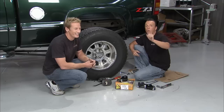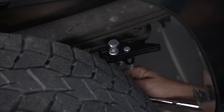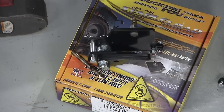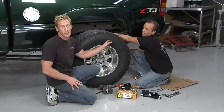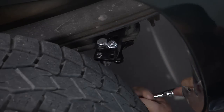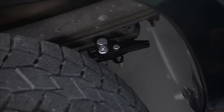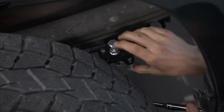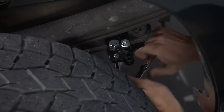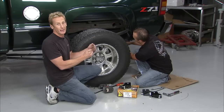The install goes in pretty quick, and if there's a situation where you have to do drilling, they give you the drill bit you need. Most of them will bolt right into place for most applications, and it engages and disengages in a matter of seconds. The idea is when you've got no load in the truck, you disengage the Stable Load and you've got your factory suspension settings. But before you load it down, you engage the Stable Load and it engages the overload spring to give you a nice, stiff suspension in the back — it's not going to sag, not going to get that body roll, and it's going to make your ride a whole lot better.